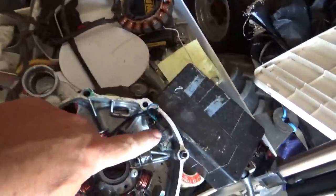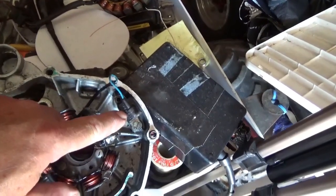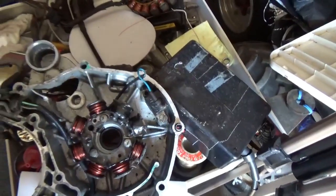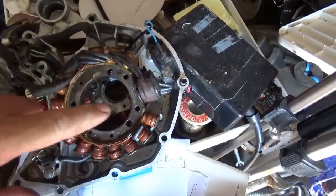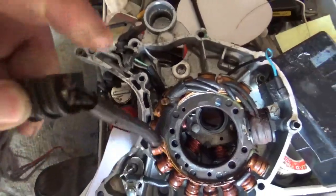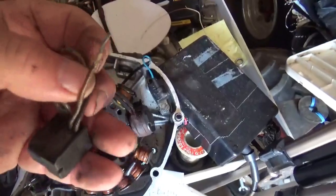On a Honda, there's the pulse generator and you see this blue wire coming off of it — that's the most important wire. The second wire coming off the pulse generator actually goes to ground; they did that for you, it's all done. On a Yamaha Grizzly, there's the stator. If you look back to the plug, you'll see I cut a couple of wires here. Here is the pulse generator for that and both wires come out the plug on the end here.